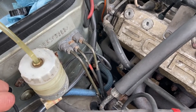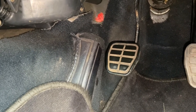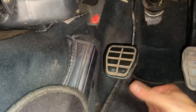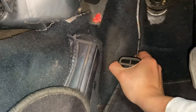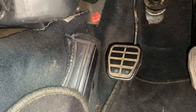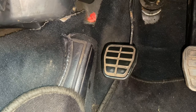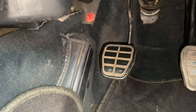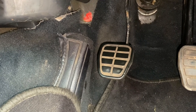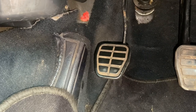My next job is to go and clear that up because I'm about finished bleeding now. But the first job is to check that I actually have some pedal feel. So here goes — we are in the footwell, which with the light on the camera looks really rather disgusting; I think we need to give this car a clean. But let's see if the pedal goes to the bulkhead — no it doesn't, it comes back, amazing. And pushing hard enough — yeah, that feels like it's operating the clutch. So I think we're on a winner. The only problem is I've got to put the starter motor back on to test whether it's actually working properly, but yeah, all looks good so far. So let's go put the rest of the car back together, clean up the brake fluid that shot out of the bleed nipple all under the car and on my crawl board, and hopefully take it out for a test drive.